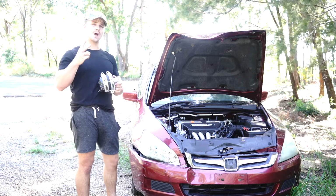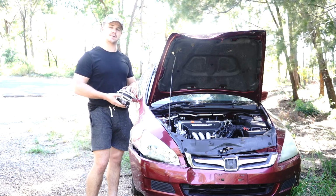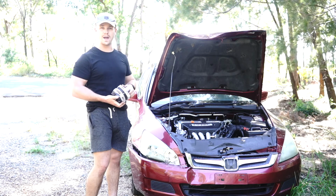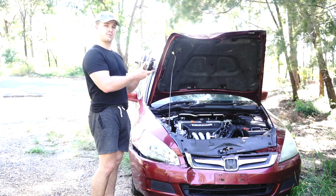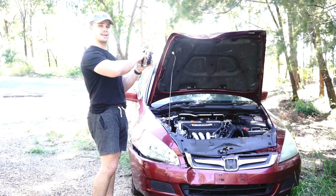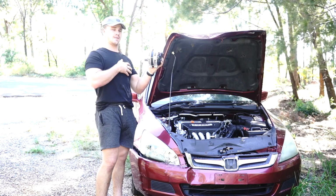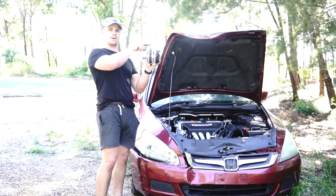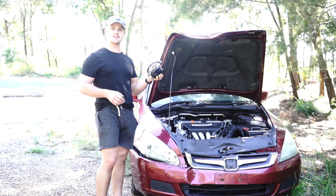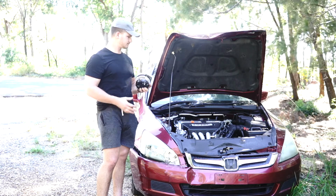There are two types of alternators. If you are thinking about purchasing this product from us, you want to make sure that the one you require is bolted from the front, pops up against the engine like that, and the bolts go through the side like that, instead of the alternator coming in on the front of the motor and the bolts going through, one that way, two on the bottom. And make sure that the alternator you require is the north-south version, not the east-west version.